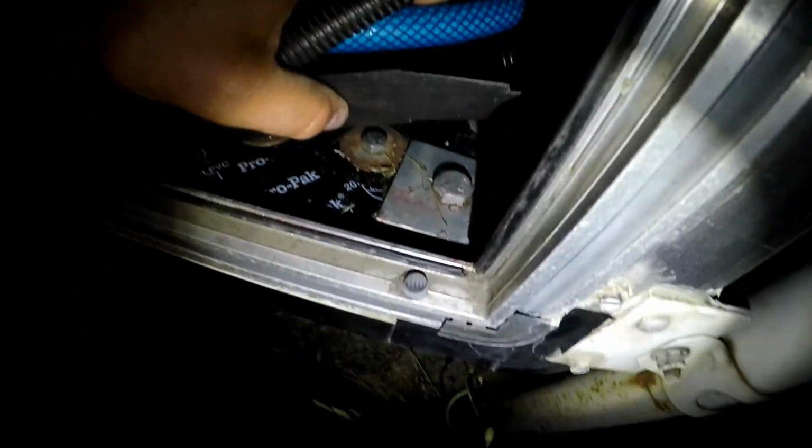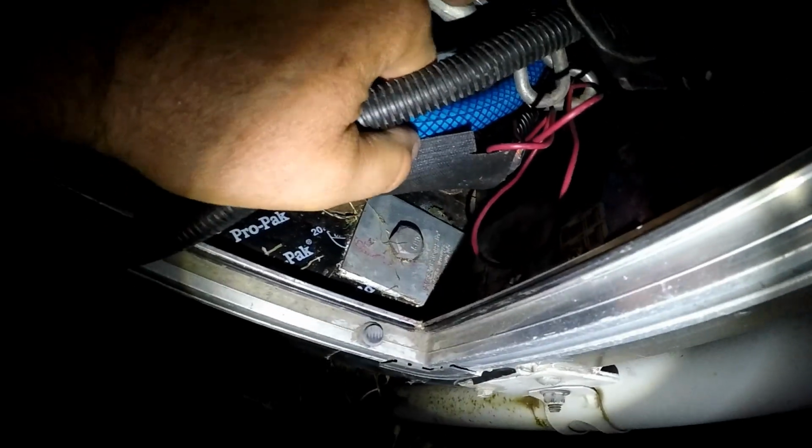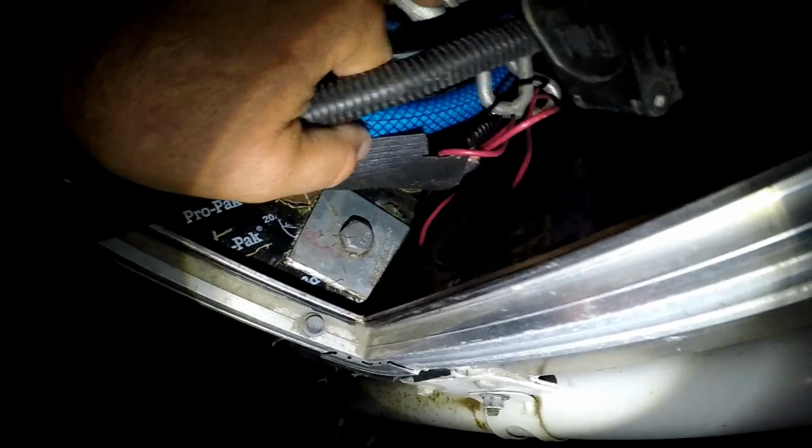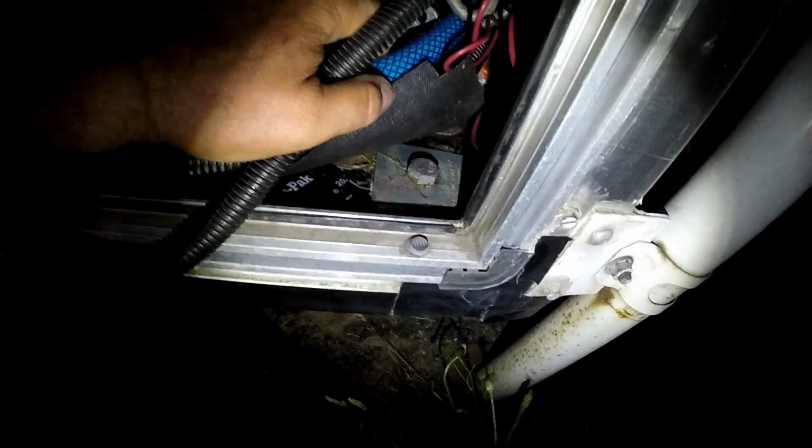It has bolts and washers that go in the floor of the compartment, and I didn't consider that to be strong enough. You could see that it was straining the floor of the compartment if you put weight on the deck, like one person standing on the edge here, and you could see significant gap forming between the mount and the truck camper, and also flex in the bottom of the compartment.